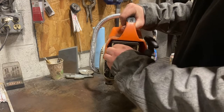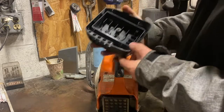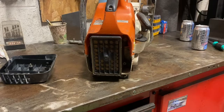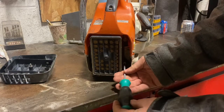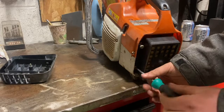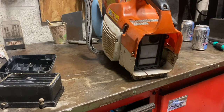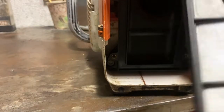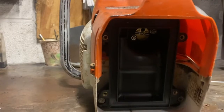It's got an air filter in it — good news. This is the pre-filter in the back here. This stuff's pretty important on these demo saws. When you're cutting concrete, the dust is no joke and it will tear up cylinders like you've never seen before. This rear air filter does not pry out — it actually bolts in with a couple T25s. Underneath that you've got this final screen filter. Stihl knows what these saws are made for; they don't play games. This concrete dust is no joke.